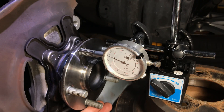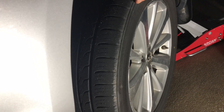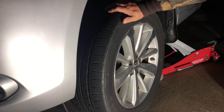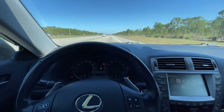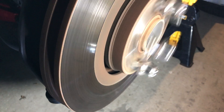In addition, remove the brake rotor and check for wheel bearing looseness and the wheel bearing hub run-out. In some cases, the issue may not be with the warped brake rotor, but rather with a failed wheel bearing and hub assembly. On my car, the run-out was double the maximum allowed value. This explains why my brake pedal was pulsating and the steering wheel was vibrating when applying brakes.